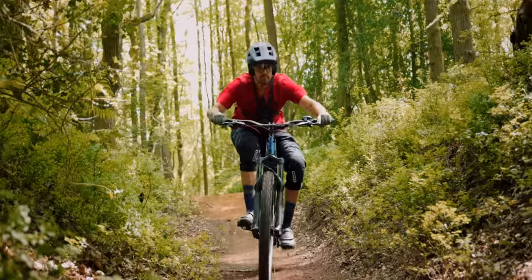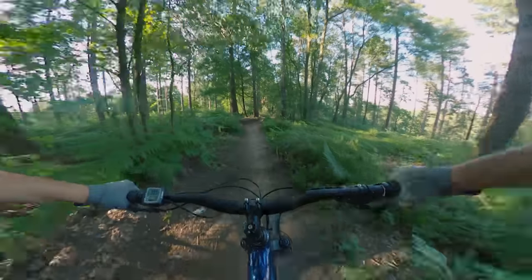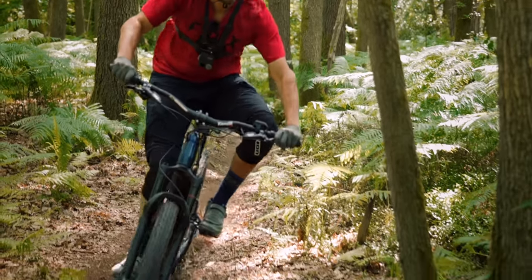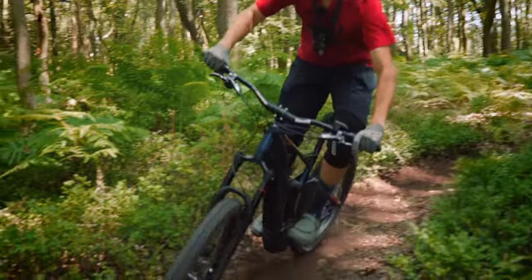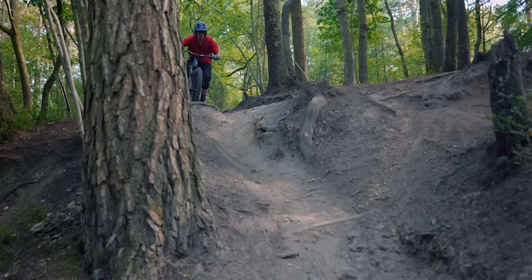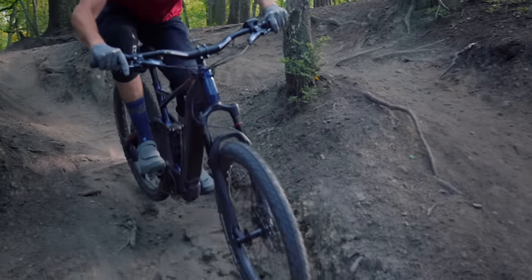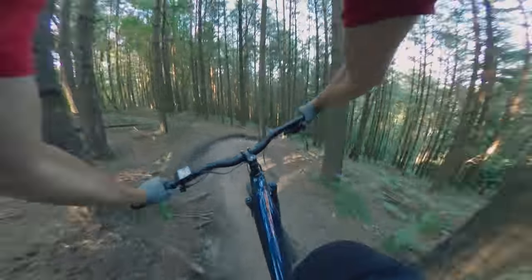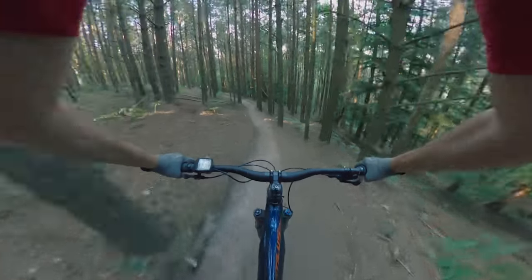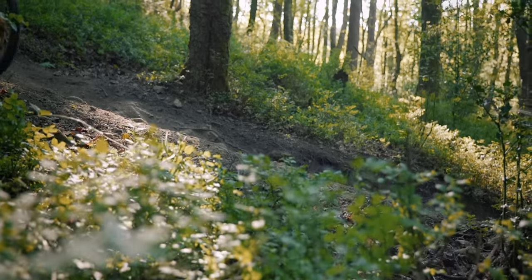The bike is definitely on the small side for taller riders. It's got a really short reach with a really long chainstay. It's also got a bottom bracket that's quite low for an e-bike — I measured it at 335mm. A long chainstay with a low bottom bracket makes the bike feel quite stable, although a low BB can make pedal strikes a bit more regular, but with technique and practice you can virtually avoid all of them. As I'm tall, it felt a bit twitchy at the front — I had to really think about my position so my weight wasn't too forward-biased. It didn't take too long to adjust, but I can't help wishing for a longer reach.